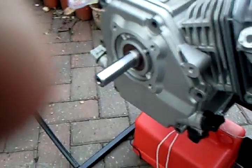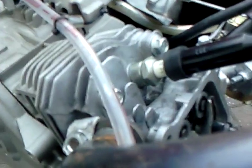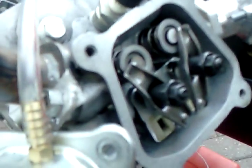Just in case, while putting the bolts in the conrod, I oiled the cylinder head bolts and torqued them up properly. Pretty much everything's back on — I lost the lash cap but managed to find the other one, so nearly there now.